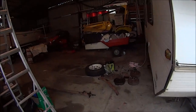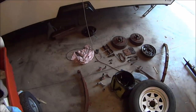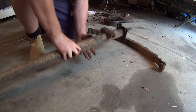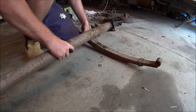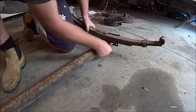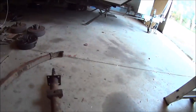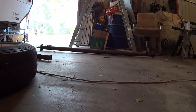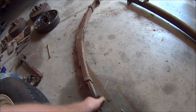I've just started doing the suspension. The plan was to pull the old axle and springs out and invert them. Before, the spring pack was sitting underneath the caravan. I'm going to rotate the axle and put the spring pack on top. By doing that I gain the thickness of the axle and the thickness of the spring pack in height, giving me a bit more clearance. In doing so, I've realised that this axle is badly bent — bowing hard like a banana — so I'll replace that with a solid axle. I may also replace these spring packs because they're looking a little worse for wear.